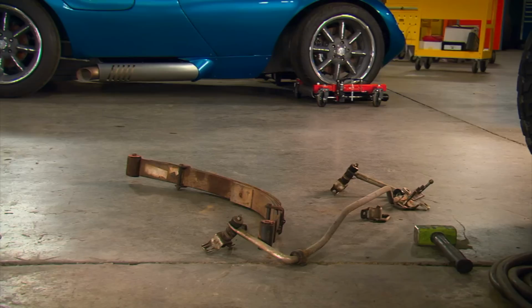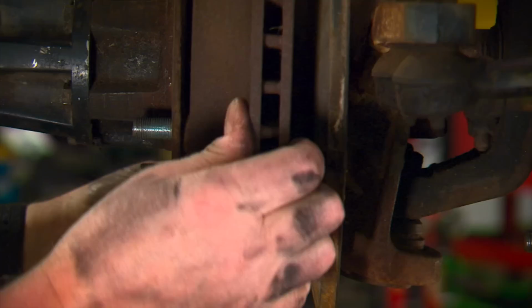For example, we replaced the old piece together 4-inch lift with a new Skyjacker lift, shocks, and extended brake hoses. We also corrected some wheel bearing and suspension issues and put new gear lube in the axles, the transmission, and the transfer case.